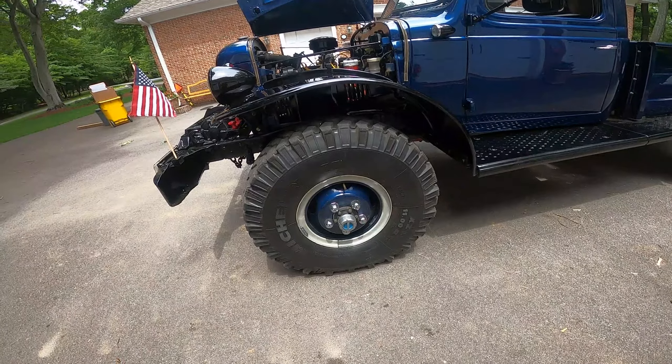What have we done to this truck? The engine's been rebuilt. The transmission is a New Process NP-420 — that's been rebuilt. The transfer case, NP-200, that's been rebuilt. On the front there's a winch called a Braden MU-2 — it's a 10,000-pound winch with a massive cable and chain on it. I've never used it for real; I use real winches today. This thing is scary and sketchy — you need a man inside who can hear you on the clutch, because the clutch is what makes it go forward, backward, and stop. If you're 100 feet away and somebody says stop while he's drinking coffee or lighting a cigarette, you're going to have a problem. They sold lots of these with the winches.